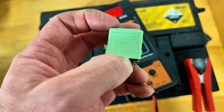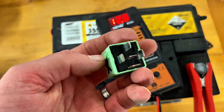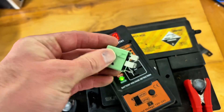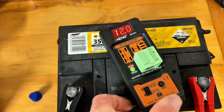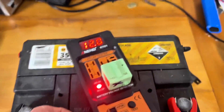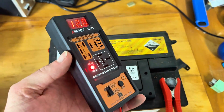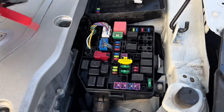Now let's try one a little bit different and see if we get a green or red light. You might have noticed that the configuration on this one is not quite the same as the black one. Red. Now this is a non-standard relay — it's configured a little bit differently; pins 30 and 87 are switched around. So it doesn't work in this tester, but most standard relays do, and it's well worth having.